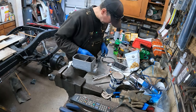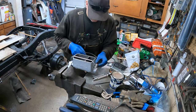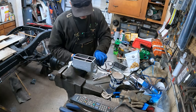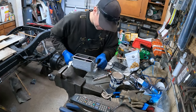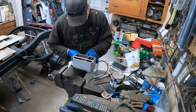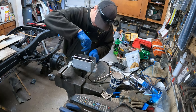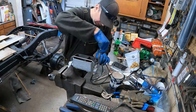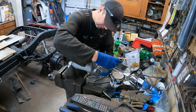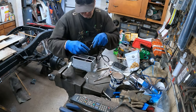In order to do this, we need to pump fluid from the master cylinder back into itself. You can bend up fittings and make hard lines, but I have a little kit with plastic adapters and rubber hoses that thread into the master cylinder. The rear brake fitting is a little bigger — the front is half-20, I think the rear is 9/16ths. You just crank these little plastic jobbers in here and they're flared to fit the master cylinder just like a piece of line, so they seal up and you get this little hose setup.